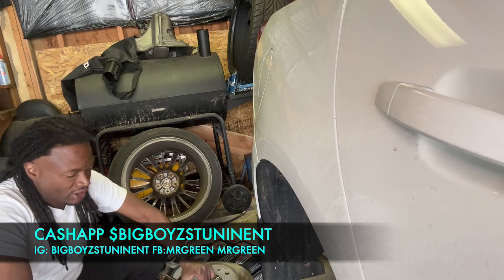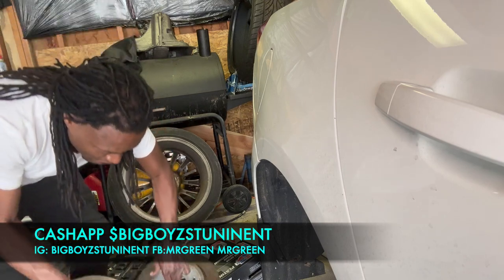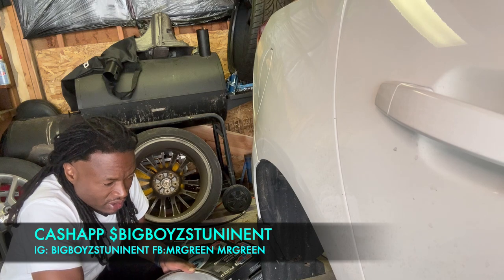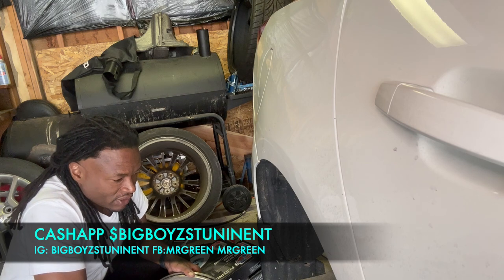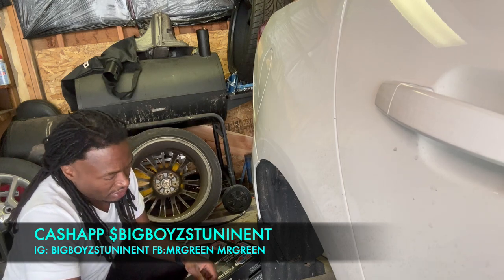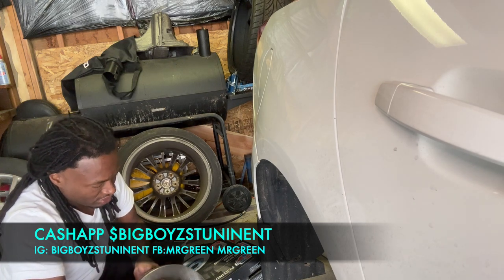Got the wrong size. Now this is how this worked, y'all. If you guys can see these rotors, you can see the major big difference. They got the same hookup, same hose, everything fit — but this is a bigger rotor. So what I learned today is with the LT Chevy Malibu's, this is what I'm putting these rotors and brake shoes on. This is an LT model. So the LT models, they say, have two different sized rotors. Just be careful when you guys order your rotors, because you can end up with a bigger rotor that don't fit your car. It's a lot of headache to deal with, to take it back and all that. So just to give y'all a heads up.